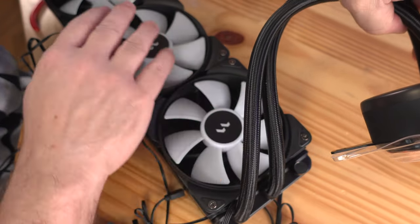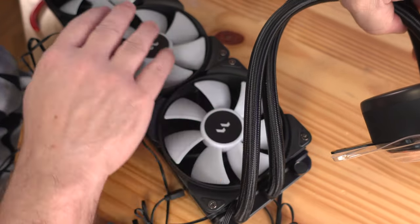Bringing in the liquid cooling unit — the radiator — these cables are kind of short. I have extensions but they don't come with the package, so I'm not going to use them. Connect the pump to the CPU fan header through pins one through three. Then find the connector for the fans and connect it to the CPU header number two, which is a four-pin PWM. Then bring the ARGB cable up through here so it's a bit hidden, and connect the female end to the male end on the opposite side of the fans so we only need one ARGB header on the board.